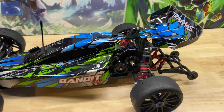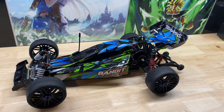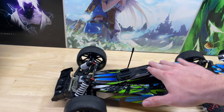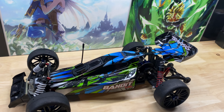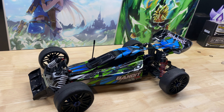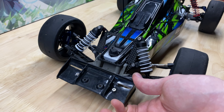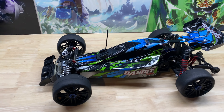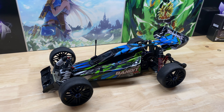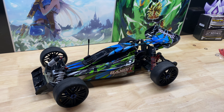It's actually heavy — you'll see why in a minute. 31/31 gears, so I finally got a one-to-one ratio on this, really excited to try that out. The over-gearing was too much — if you guys saw the 92 mile-an-hour video, definitely too much, I don't recommend it. This car as it sits weighs 6.3 pounds, and what is now running it is 6S.